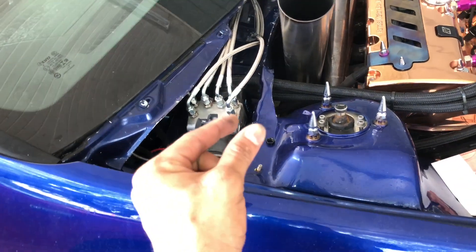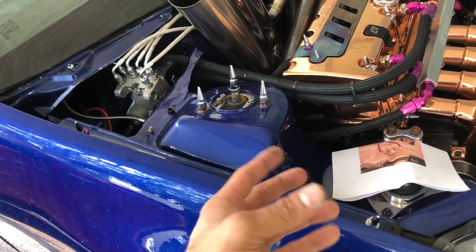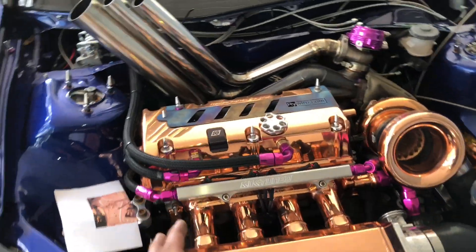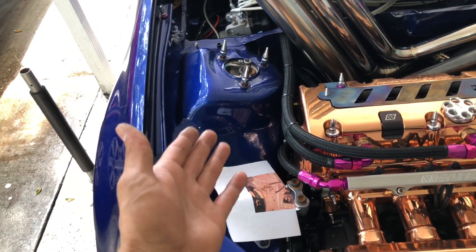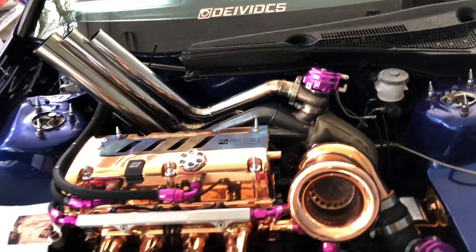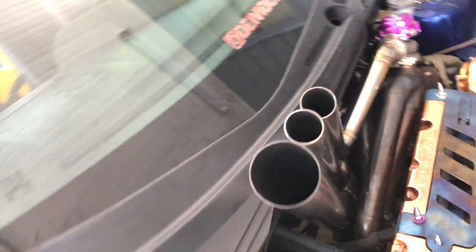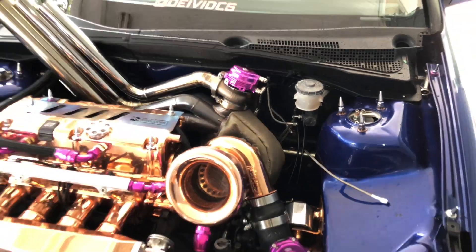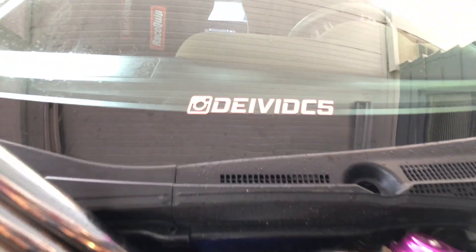Do note: use the same wiring gauge when you extend the wires. Don't use anything thin — it's better to use something thicker than something too small, because undersized wire will get hot when you're driving and you don't want a fire or any sort of mistake that can cause your car to catch fire. Be really careful when you extend the wires. As you can see, those are the only two lines you will be seeing. Thanks for watching guys — any questions, please leave them in the comments. You can also contact me through my Instagram.